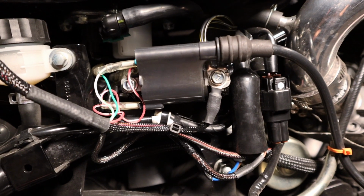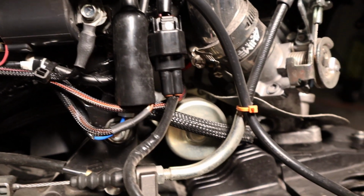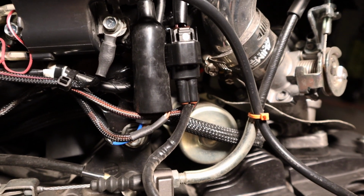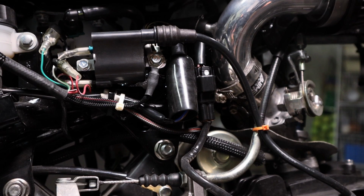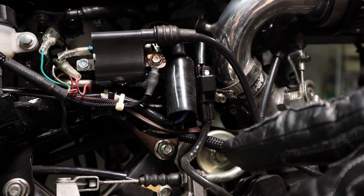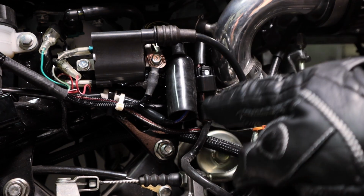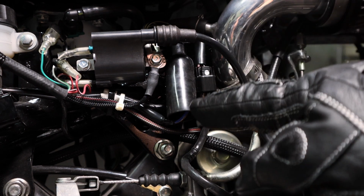The second install point is the crankshaft sensor connector. It is located under a black rubber boot, which are my favorite type of boots. Be advised that the correct boot is on the opposite side of the bike as the ignition coil. The connector will fit under this boot near the first install point.